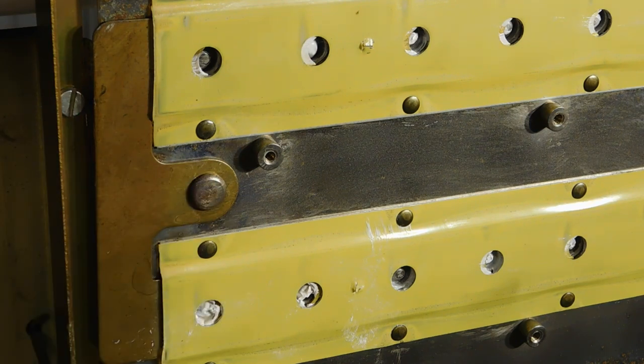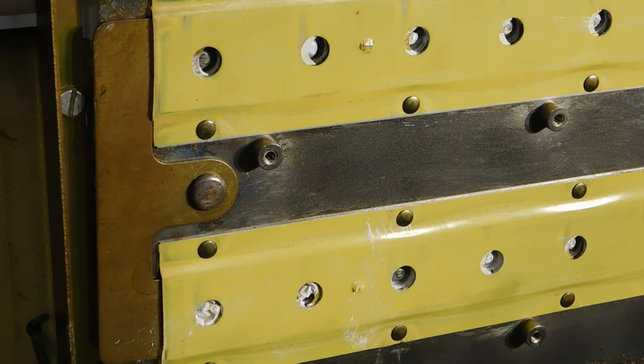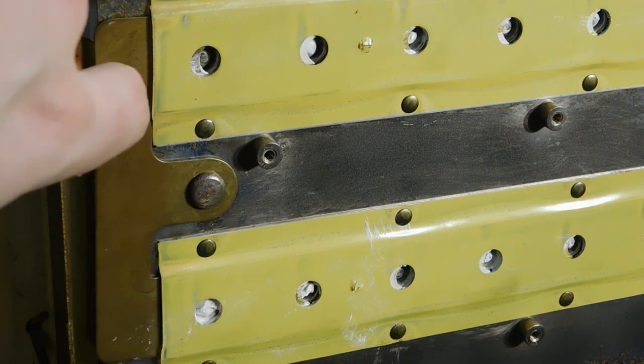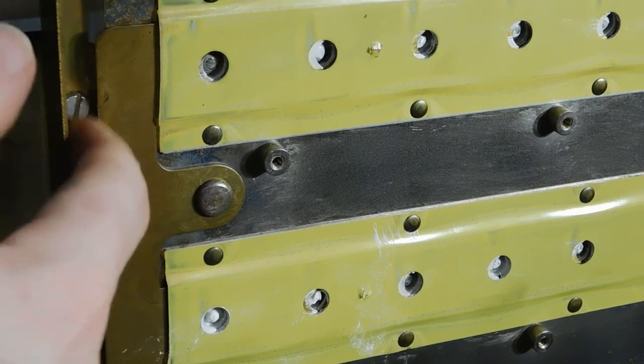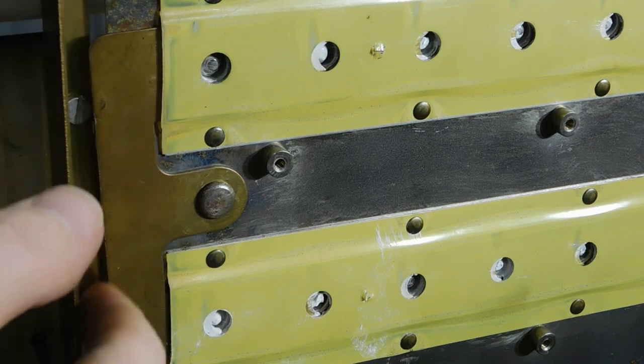Now that I've got this all lubricated, I wanted to show you this neat mechanism that keeps you from pressing multiple selections at once. Whenever you press in one of the buttons, this part here will block all the other buttons. That way, you can't push more than one thing, since there's no computer in this to tell it not to vend more than one thing at once.